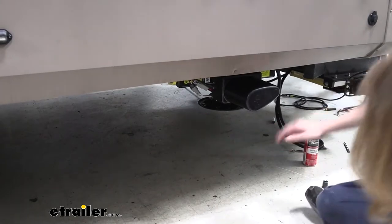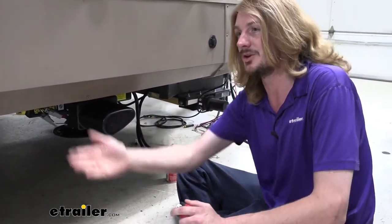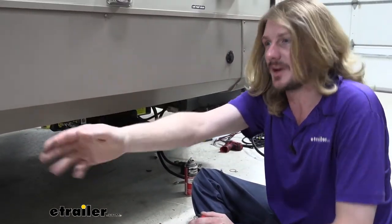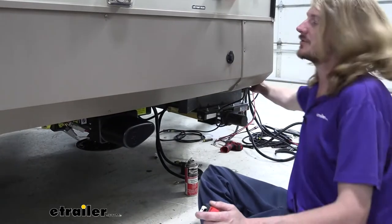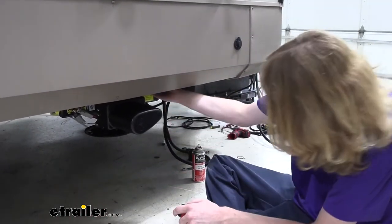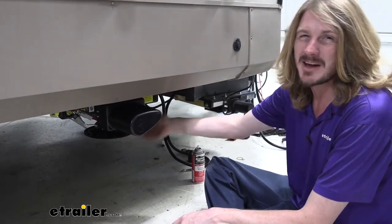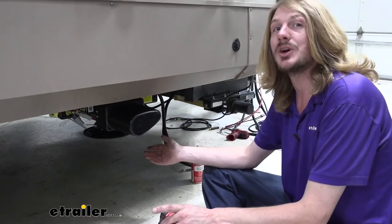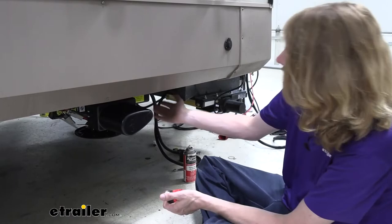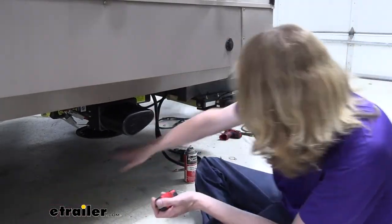Anywhere in there is a usable range that you can install this in, but it does still have that same restriction of ground clearance, so you're going to do the same thing by placing a string at the front of the front tire there at the ground. We're going to check the angle up to the front of the trailer and make sure that we never cross that departure line. 9.5 inches is roughly what you see here. It is actually a little bit shorter than 9.5. It's about 9.25, but I recommend making sure you're checking with 9.5 to ensure that you do have the appropriate clearance once you've chosen your place to put it. And this location that we've chosen here will clear our departure plenty.